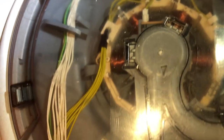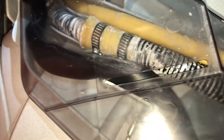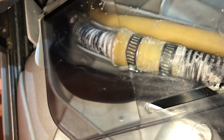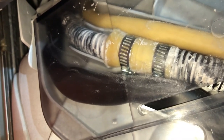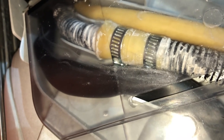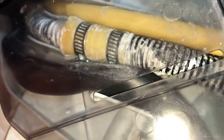I've got all my wires routed back through. You have to reconnect this here as well as on the front panel, and run this supply line up here. This is the sound of the dishwasher draining — water being pumped through this right now. Nice humming and no leaks, so that's exactly what we were hoping for. You can either replace your hose or repair it this way. Be careful — make sure that you can actually route the hose, as my hose has been routed through some crazy places in the cabinets. But that should give you many more years of service.